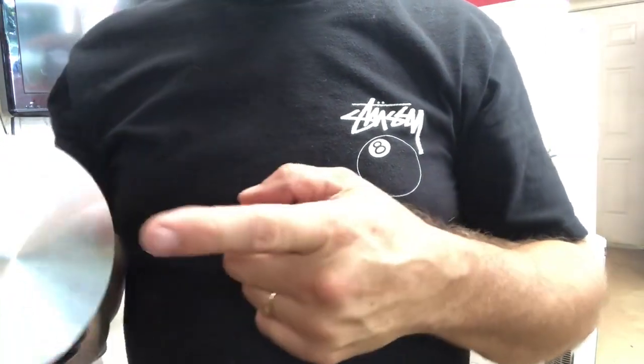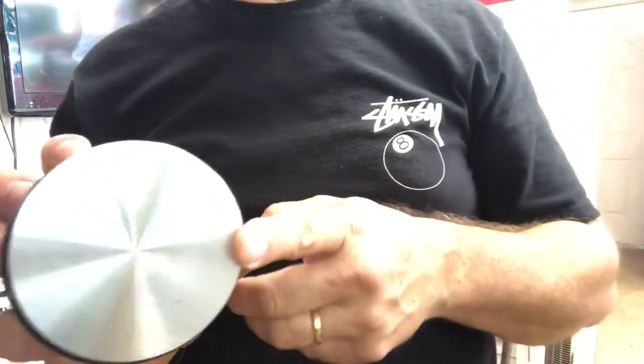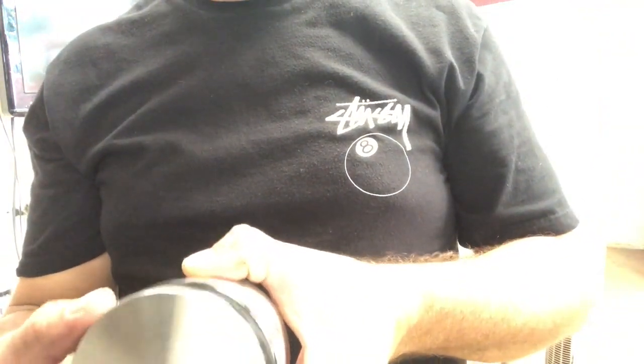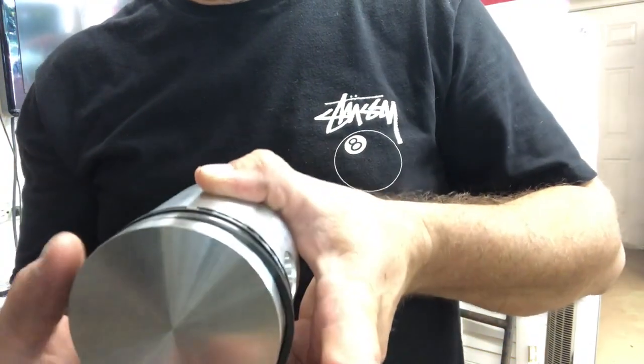So we've got our arrow pointing. Wow, it's hard to see on this thing. There's an arrow, it's pointing to this side. When it's in this position, I want to go ahead and put my ring gaps. So that's these spaces right here.